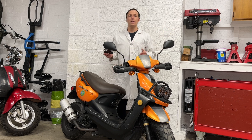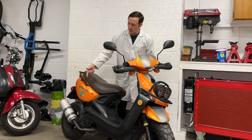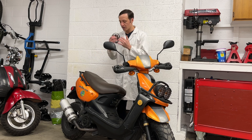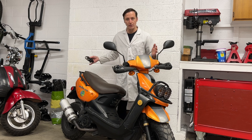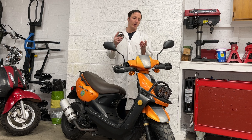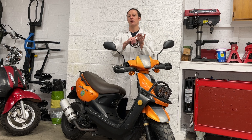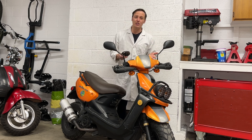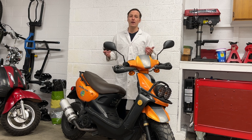Hey everyone, I'm Paul and today I'll show you how to replace the stator in your 150cc GY6 engine Chinese scooter. This scooter was a bit of a disaster and a ton of things were broken — I have an hour and a half long video about how I fixed everything. It had a lot of trouble with the ignition system. It didn't have spark and I tried replacing the spark plug, the ignition coil, and the CDI and it still wouldn't run. Then I replaced the stator and it ran but the charging system didn't work. What a mess. This is the story of what happened and how I finally got it to work.